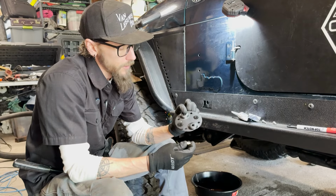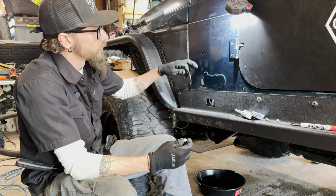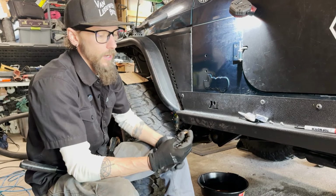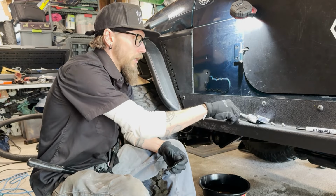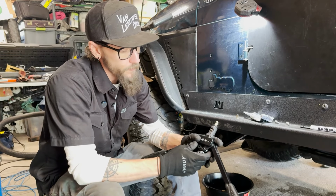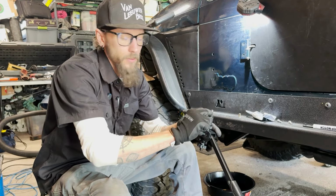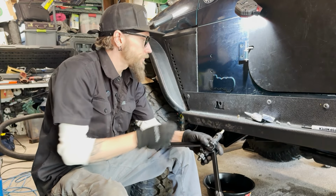So to install these brackets that come with the Rotopax, flush mount these up here. I drilled a couple holes into the body here. There's nothing behind that, just kind of a dead space. I'm gonna use these riv nuts. I've never used one of these before. It's that little ferrule, I guess. This is a riv nut setting tool. And then as I apply pressure back on both of these, this will crimp this fitting to the sheet metal and sandwich it in between.